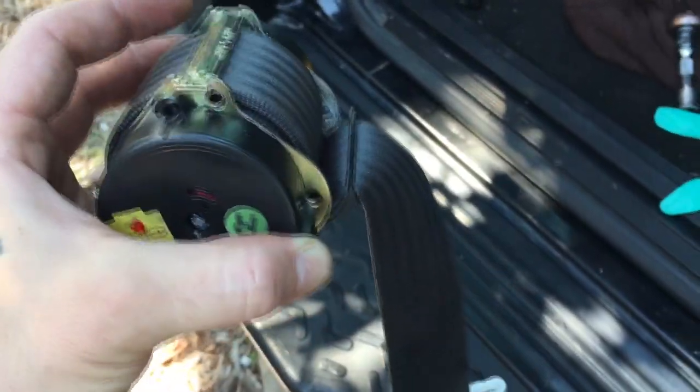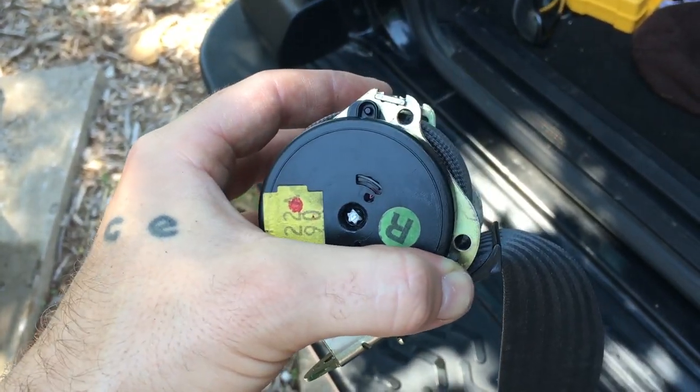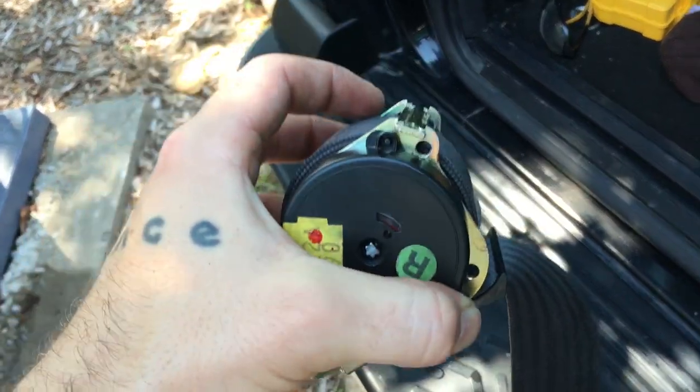Take some WD-40 and spray down all in here. Remember, this belt mesh has to be fully extracted all the way out before you can put that cover on. I just put the cover on demonstrating, but it wasn't fully out, so now I can't get it to release. I have to pop the cover off again — now it's a lot easier because I've loosened up these tabs so much. You have to pull that all the way out before you put the cover on. Then I would recommend bolting it in place up here first to keep it from retracting, then bolt it down here, and hopefully you're good to go.